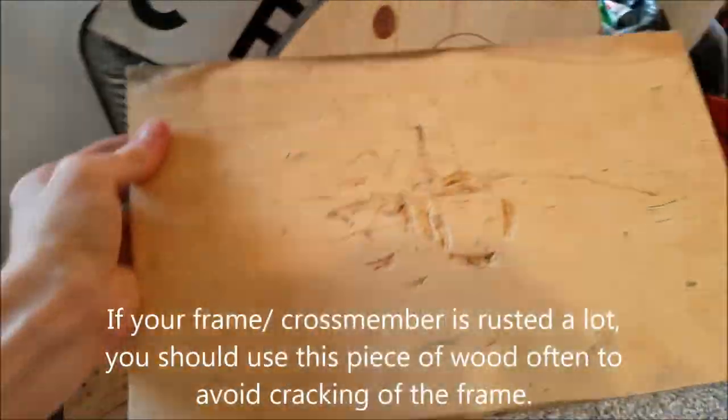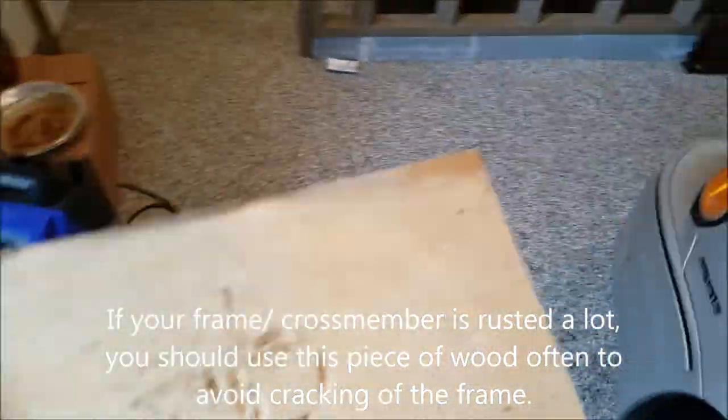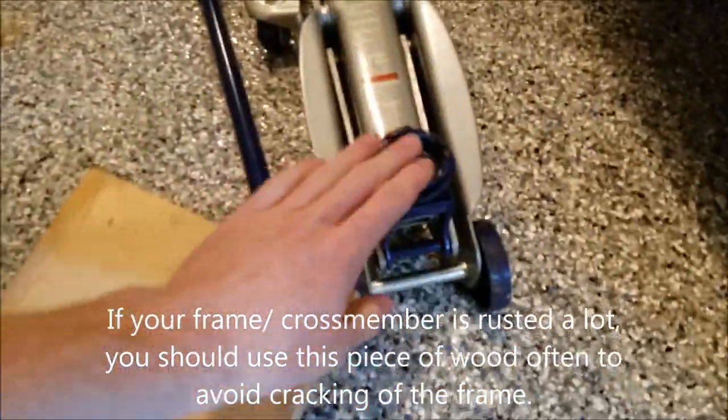Right now what we've got to do is jack it up carefully. If you're replacing your serpentine belt normally without an engine block in the way, don't worry about this — you don't need to do it, and actually you shouldn't do it because this part you have to do carefully. I have this little piece of wood here and we're just gonna put it up against here, right under the oil pan.